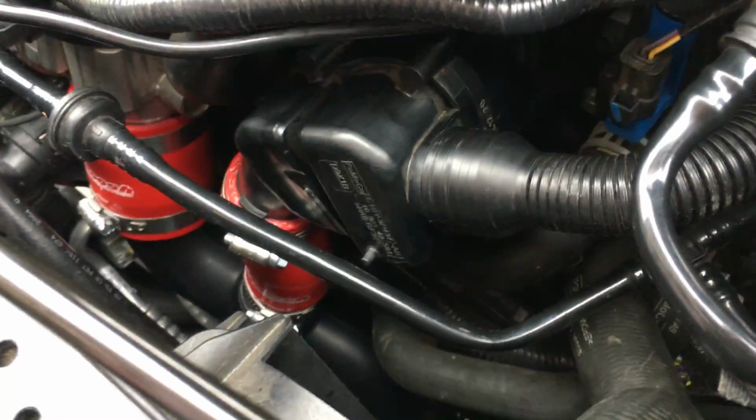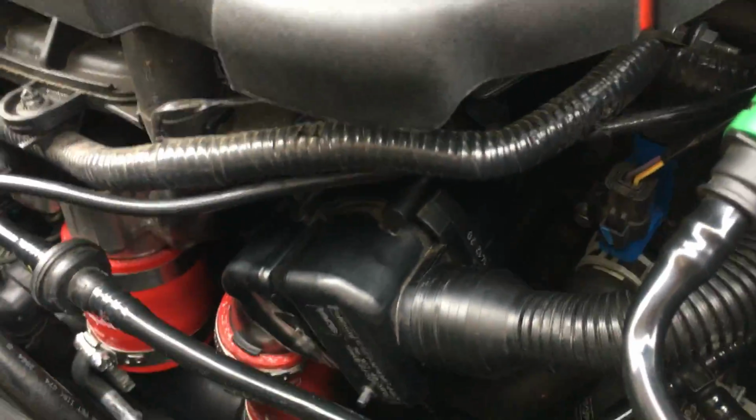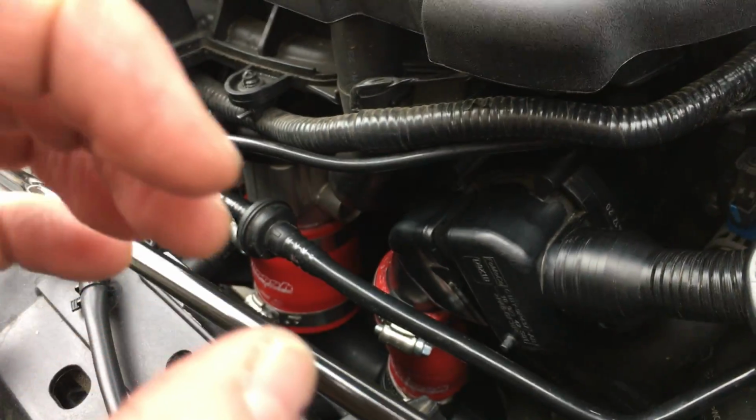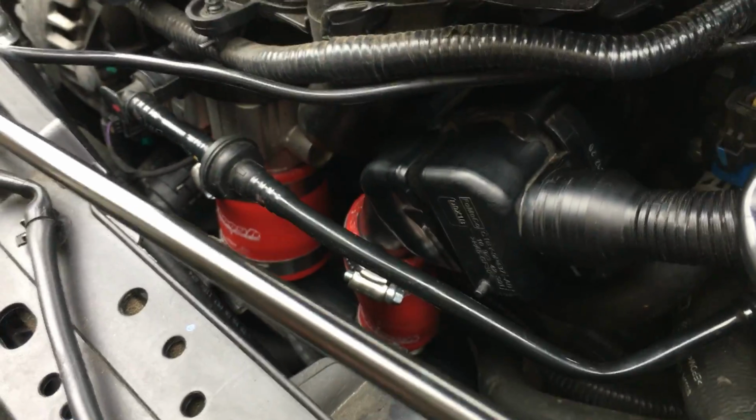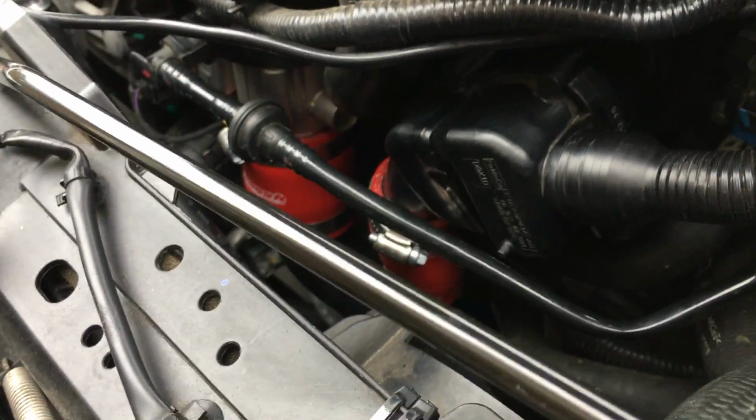I don't. I have a Mountune exhaust, and when I spent that money, I want to hear my Mountune exhaust instead of hearing my Mountune exhaust and then the conflicting sound of artificial engine noise being pumped through this thing. So I just got a symposer delete. I just got a $4 Dorman plug that fit right in there, and then you turn the nut and it just expands the rubber, and it's perfect. You can buy them for like $25, and they have like fancy writing on it, and it's a part you probably will never see.